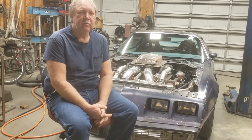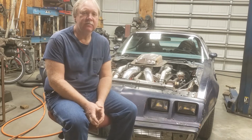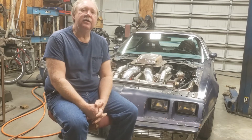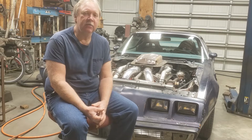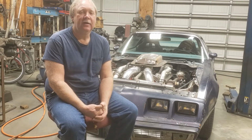Okay guys, at the first part of this video, the sound wasn't as loud as it should have been. The audio just didn't come across as good. So I'll recap what we're doing. Doing a 10 bolt here for a guy, had taken out some 488 gears and putting some 342 gears in, and we're changing from the 10-bolt ends to a Ford 9-inch end.